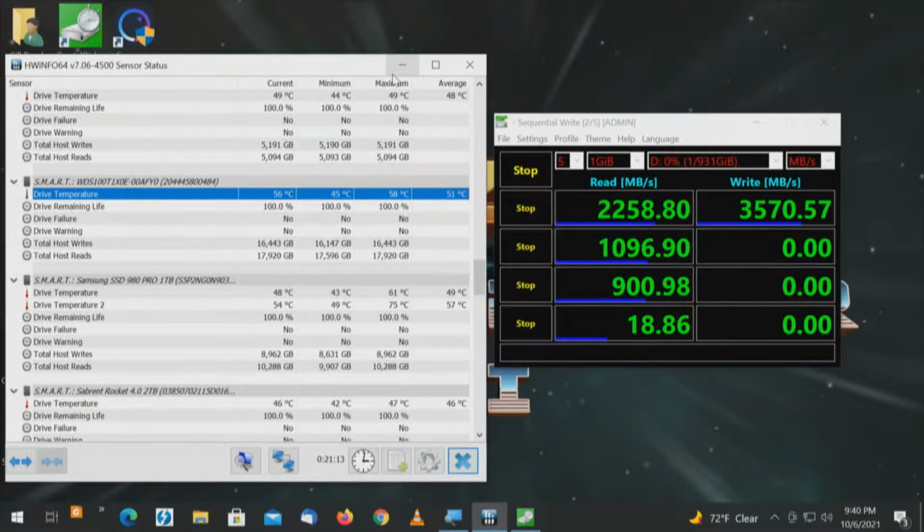Even the writes are bad. 3,500, wow. 3,600, that should be coming in just under 5,000. But I need to power down first and reinitialize the disk. Not reinitialize as in reformatting the drive. I just need to remove power from the drive and repower the drive. We'll see if that restores performance.